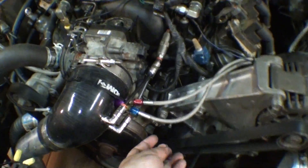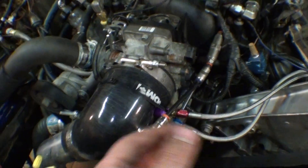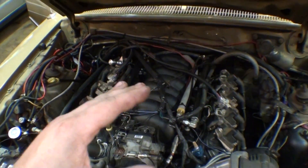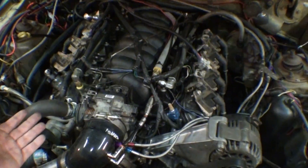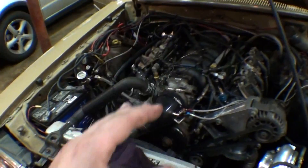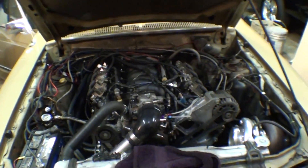The TPS sensor — you can make Megasquirts run without a TPS, but it's very accurate for throttle movement and acceleration enrichment. When you stab the gas pedal, if it's just running off the MAP with no accel enrichment, it'll cough — it'll go lean when all the air comes rushing in and there's no fuel until it hits the right part of the map. For real crisp revs, clean driving, and flooring it into boost and out of boost, it splashes a little bit of gas in there so you don't knock a ring land out.